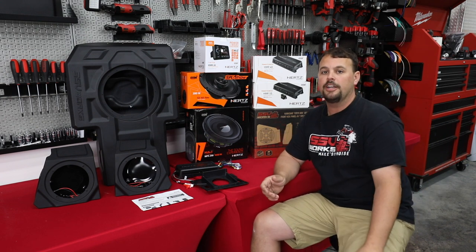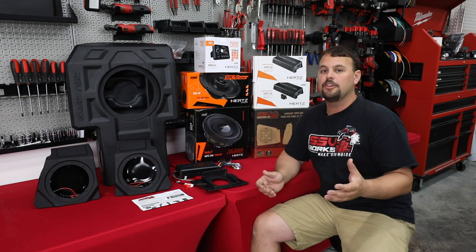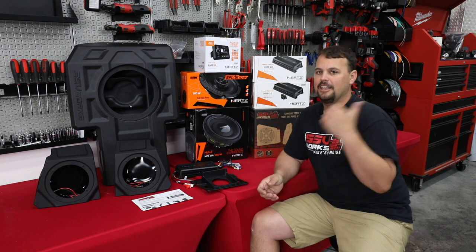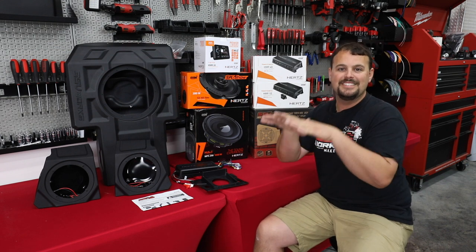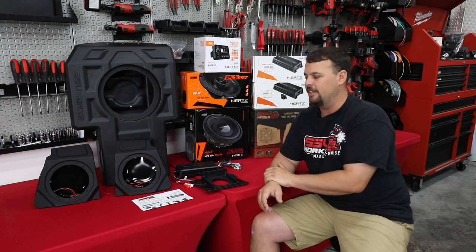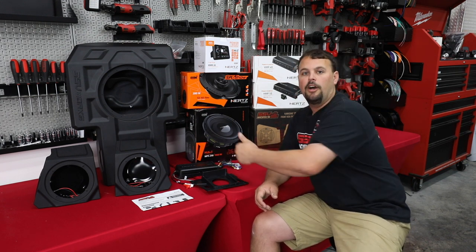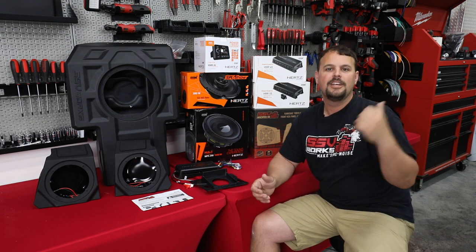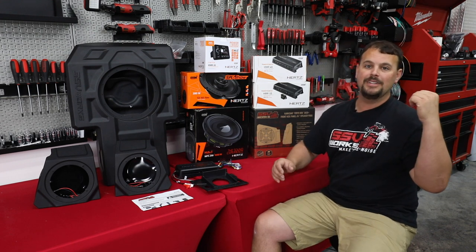All of this is available at volunteeraudio.com. If you've got questions or need other parts, we can assemble a full kit for you. Very soon, we'll have this in a complete plug-and-play configuration from SSV Works, just awaiting a new amp plate and amp bracket. In this install, I put the amps above the glove box, cleaned it very well, used large Velcro pads to stick it to the top, and then wrapped that with a large zip tie for extra security. We're running all copper wire from the battery, new runs of power and ground to each amp, and added another run to the accessory plate. This thing's got heated seats and it's loaded, so we had to have a place for all those things to tie in also.